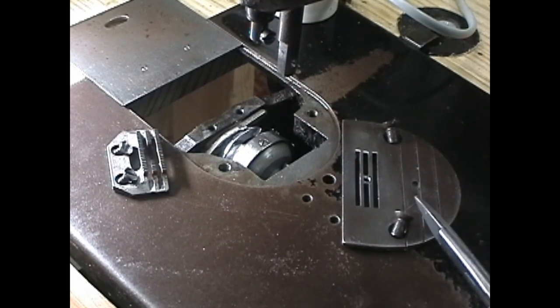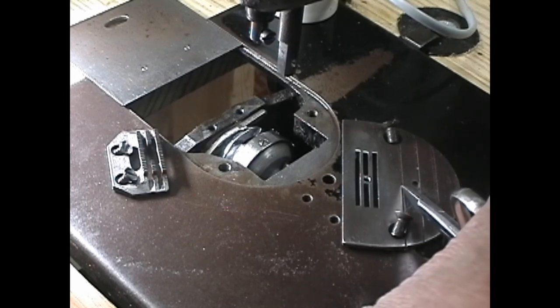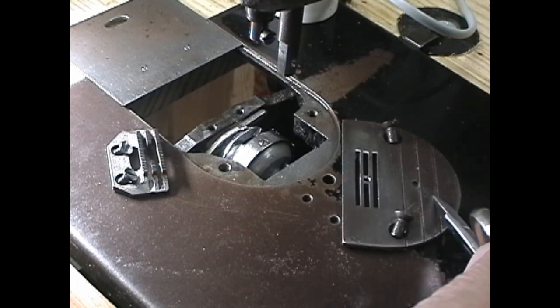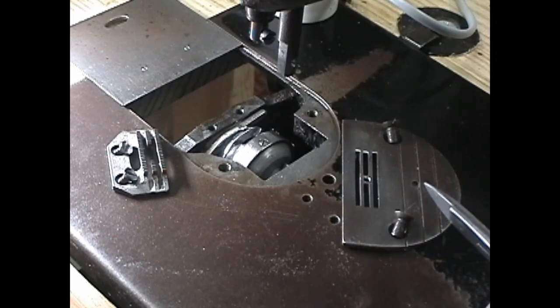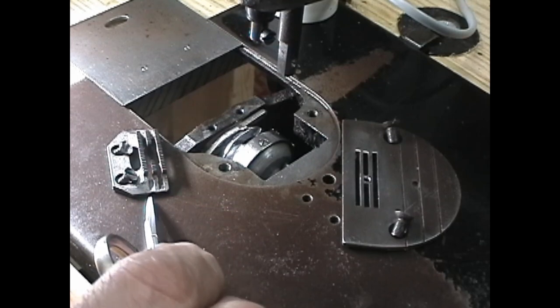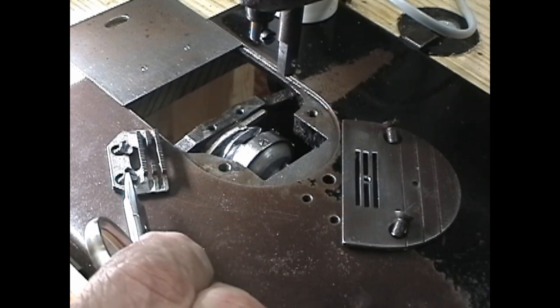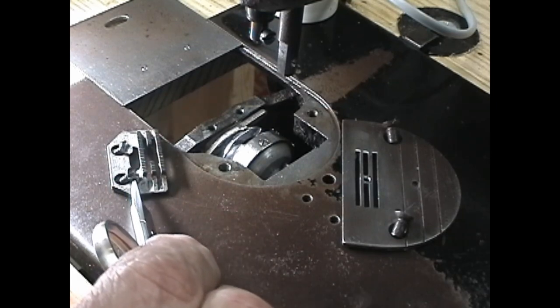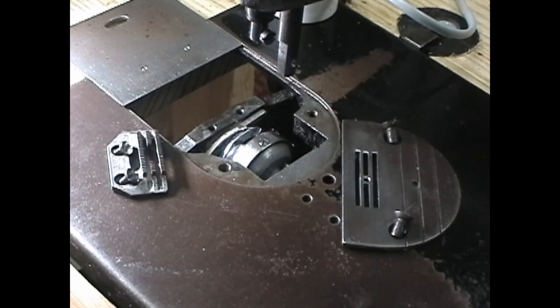I did this for a couple of reasons. One, I wanted you to be able to identify the screws that go back in with them, because you are going to move them into a container and they may roll away. This is a standard seam-width-measurements needle plate for Singer 95-1. Here are its two screws — they have countersunk slot heads. The feed dog that goes with this needle plate has two shoulder screws that are slotted on top.